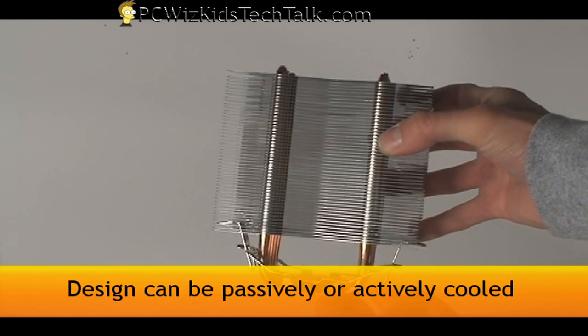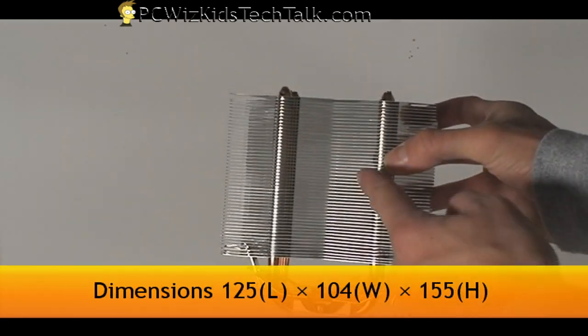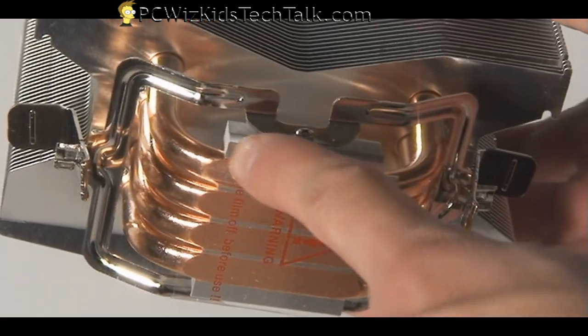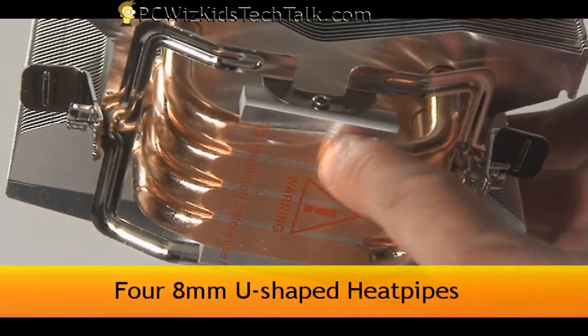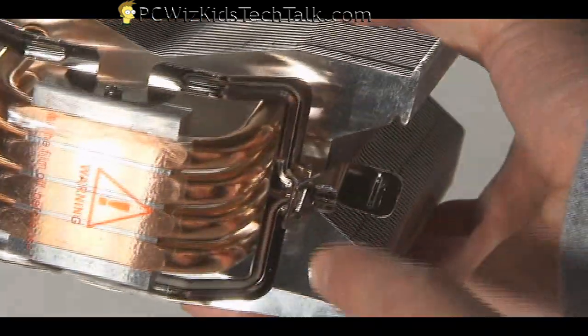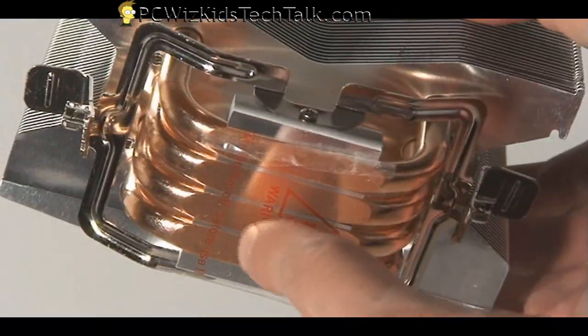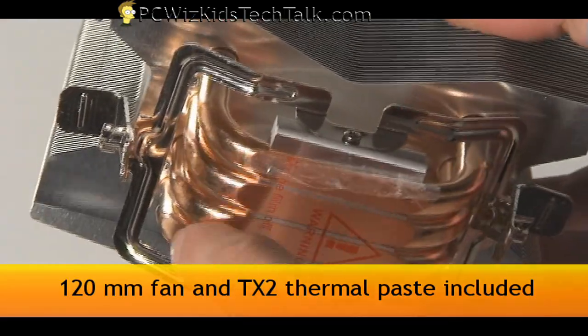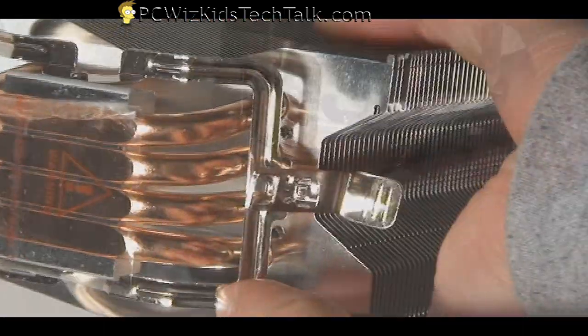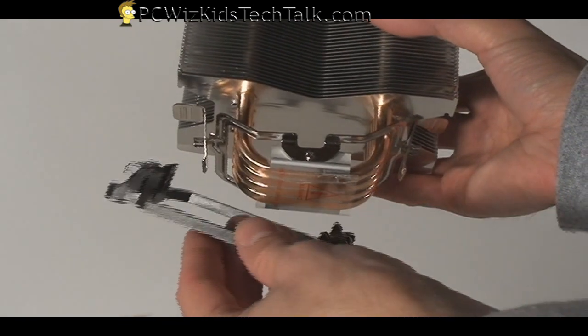it's got a tower design. It's straightforward — 50 fins going across from top to bottom and four heat pipes going through it in a U-shape all the way through those fins. We've got these 8mm copper heat pipes. It comes with the nice little clips that attach to your bracket on your motherboard, and it even comes with a 120mm fan and thermal paste. So the kit is a very complete kit.